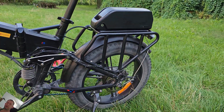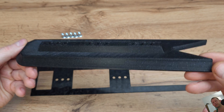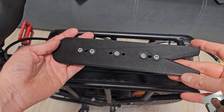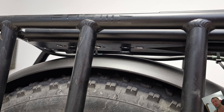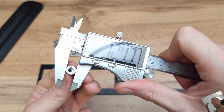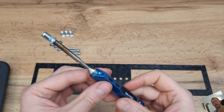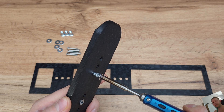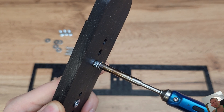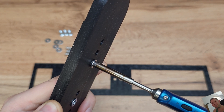If I find it on AliExpress, I'll link it in the description. Now if you have a 3D printer, you can print those two parts — links for the files are in the description. For the biggest part, I recommend using nylon or high-quality PETG or PLA, because there will be big tension from the screws holding the battery, so use high-quality filaments. You'll also need to use metal inserts — you can see the size on screen — and melt them into the big adapter. I set my soldering iron to 270 degrees and it did the job. I also added a version where you can use simple wood screws, which is much easier, but I'm not sure how long it will last.